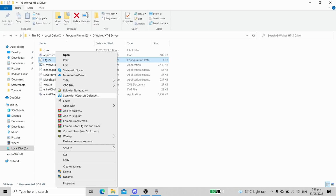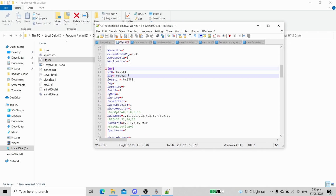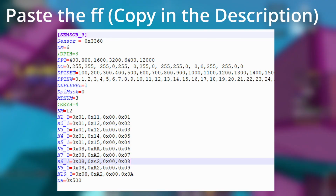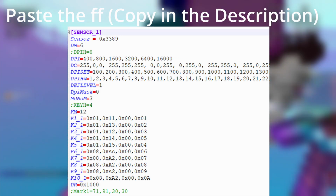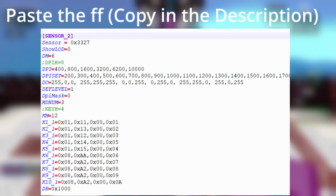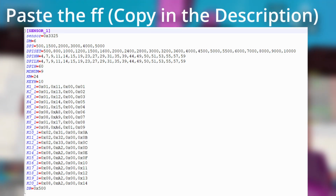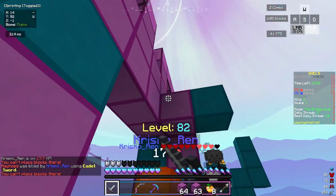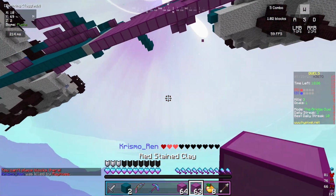Step 7. Open the cfg.ini file of the mouse software. Find the PID and replace that with your current copied PID that you got on step 6. Step 8. If the sensors are different, you can try pasting the following. For a 3360 sensor, paste the following. For a 3389 sensor, paste the following. For a 3327 sensor, paste the following. For a 3335 sensor, paste the following. For a 3325 sensor, paste the following. For other possible sensors that I didn't mention, I would be providing a copy of it in the description, as well as the ones that I already mentioned.